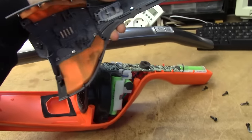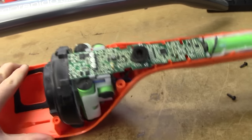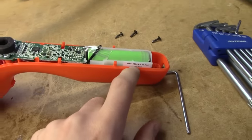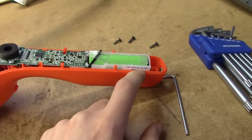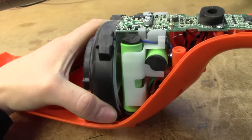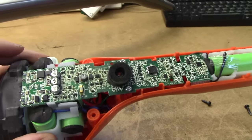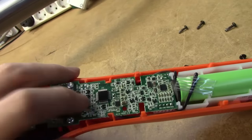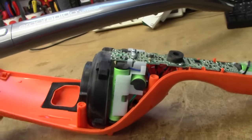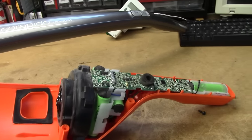There we go - the shell comes off with some extra dust. These seem to be just standard 18650s in little brackets - 18 volt, 1400-1500 milliamp hours, probably pretty standard tool-style high current lithiums. That's a pretty tiny motor, looks reminiscent of a drill motor. The electronics look pretty high class actually - some kind of processor going on there, seems to be an ST of some sort. Pretty nice build quality on this thing, I'm quite impressed thus far.